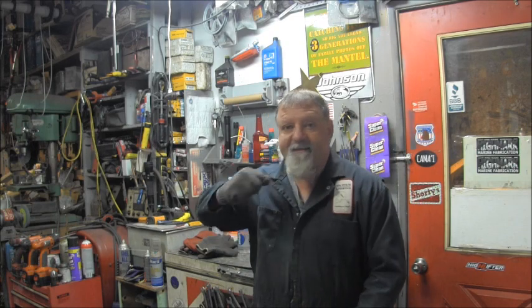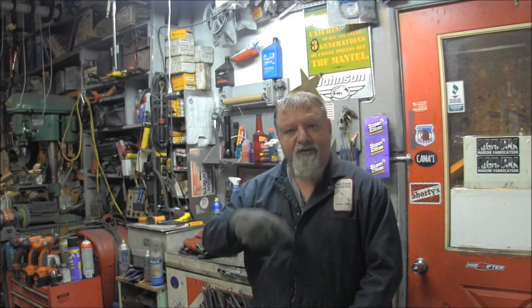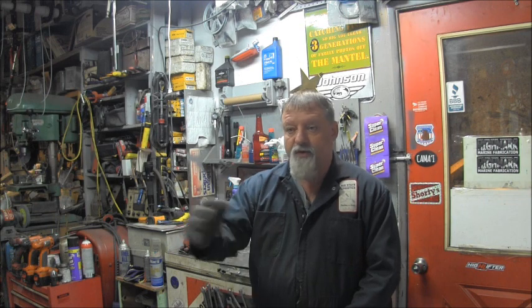But on this one, like all of them, you've got to get all that oil out of the fuel system, and that takes a lot of this. I can spin it over with the Milwaukee and get it out of the cylinders, but as far as the fuel pump, the hose lines, all the fuel lines, the carburetor, you're mostly just better off. Had I known this one had been hydrolocked, which I did not, I would have gone about this a little bit different.